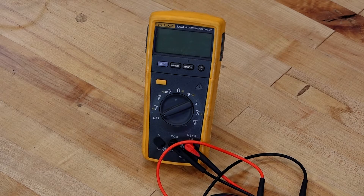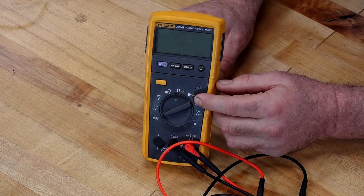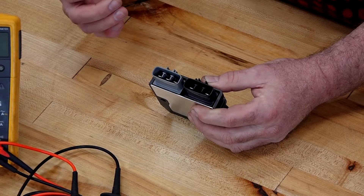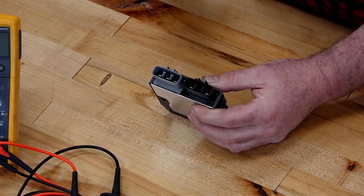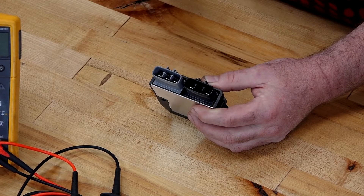You're only going to need one specialty tool — a good digital voltmeter. Just make sure it has that little diode symbol on it. What we're going to do is unplug the unit and test each point as far as we can, going from the positive and the negative which goes to your battery, and then also what goes to your stator. We're going to be looking for a set of diodes and forward biasing them — taking a voltage measurement across each diode to see if it's doing what it's supposed to do.